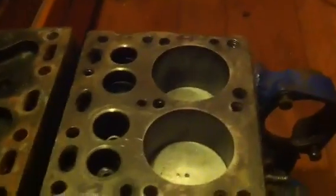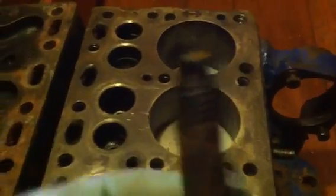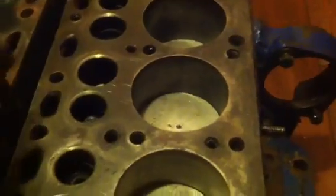I will be cutting these studs down, because this part that's already starting to corrode after a couple of years does no work — all it does is block flow. It goes down into the water passage and blocks flow between one passage and the next. If I'm cutting off a quarter inch of a half-inch stud, the flow should double, which in the future could save me and everybody else from having burnt valves. That's my understanding.